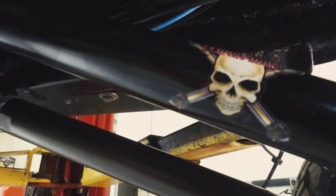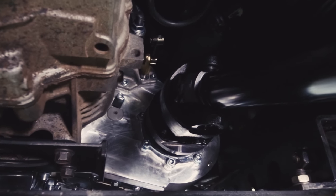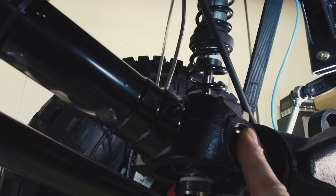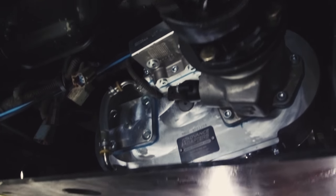We've yet to break one, which is crazy because I drive Jeeps rough, even in the parking lot, let alone off-road. This is a 1350 CV style yoke right there because we have tons of room now with the Atlas compared to the new Venture. And then a 1350 at the yoke end here. And then we have the same in the rear — a 1350 Adams at the yoke, and then a 1350 CV flange style up there.